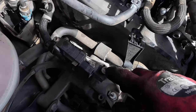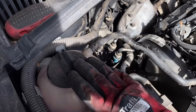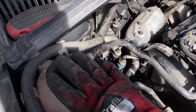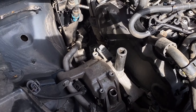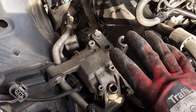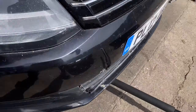I'm going to pull this pipe off, undo the two bolts, and hang that over there. Same again with the water bottle — there are torx bolts, one there and one in the corner — and then that bottle goes over there and is out of the way too. Now we're on to the engine mount. We've got 18mm bolts on these two, 16mm on these, and a 13mm there.